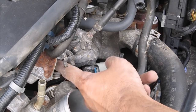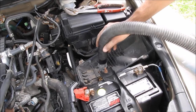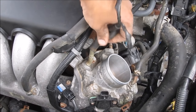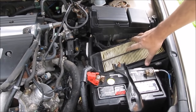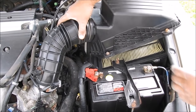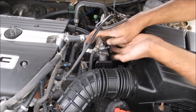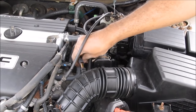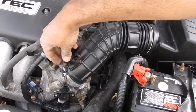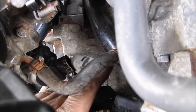Before I put the air box back on I'm going to clean it out with a vacuum. Next I'm going to replace the vacuum lines on the throttle body, then replace the throttle position sensor, then replace the air filter. Then I'm going to replace the air box with the intake tube and tighten down the 8mm bolts for the air filter. At the back we're going to replace this tube, then replace the PCV hose, then replace the air flow temperature sensor, and tighten down the hose clamp for the throttle body hose. It looks like I forgot to plug in the idle air control valve — I'm just going to plug that in right now.